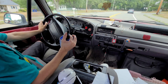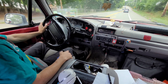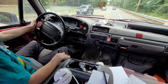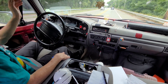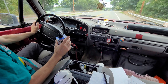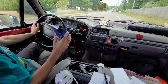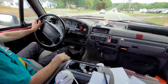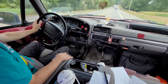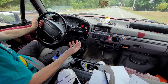What we want to do at this point is fire up and go for a quick little test drive. I'd recommend using Mercon 5, as does an old TSB from Ford — all the AOD, 4R70W, and related transmissions should be using Mercon 5 now. As far as testing the lockup goes, I can't do that because I damaged the switch when my old lockup solenoid failed — it failed short, so the contacts in that switch got melted. But the fact that it's not locked up means the solenoid is holding back pressure and it's working.